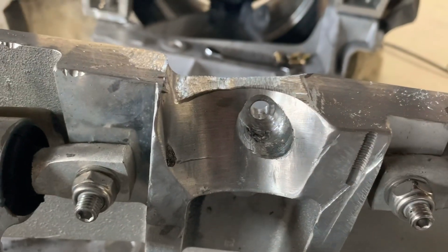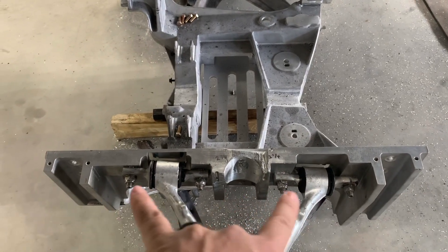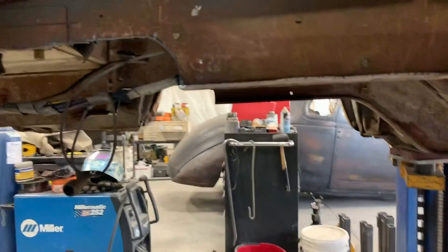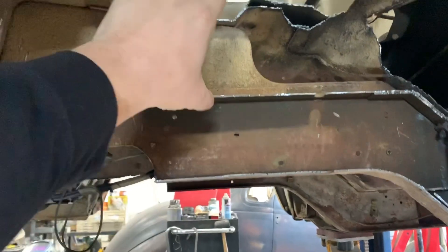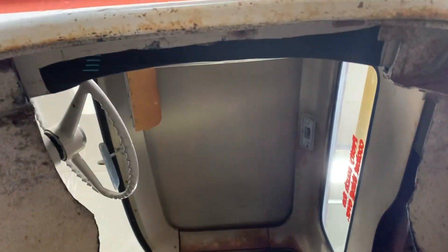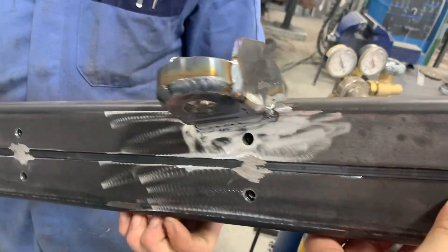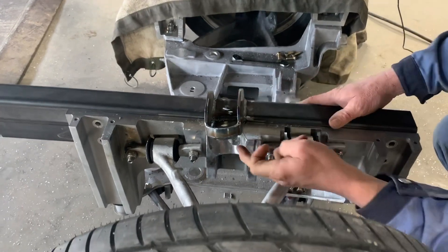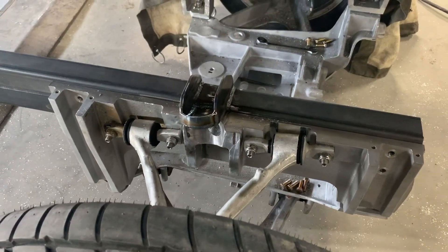This is what the mounts look like now. We've still got the mount hole to bolt this bracket to our subframe, but right here we machined this out on top where the strut fits, because this entire setup squares up to the new frame that goes up inside the Corvair. Looking up here, you can see where we've cut away the existing frame of the Corvair across here so we could get it narrow enough to fit everything up inside. Up here is where the new subframe will ride. We've had to cut a pretty big hole. Here are our frame rails with the welded bungs inside. Here's the upper strut mount — Lloyd has done a fantastic job on these. You drop them in, they fit perfect. We've got all six mounting holes still available, and then our strut fits in that new upper strut mount and sits at the correct height.